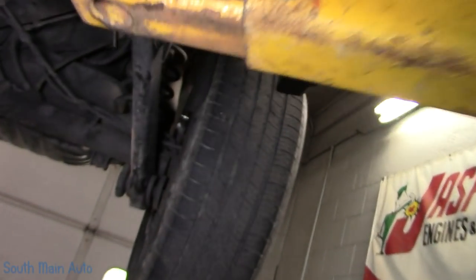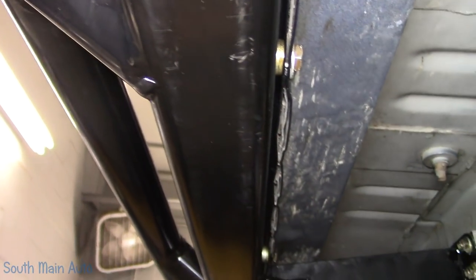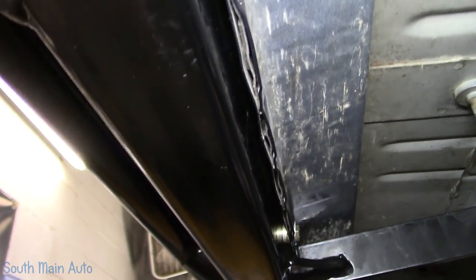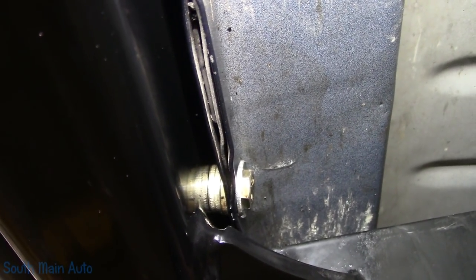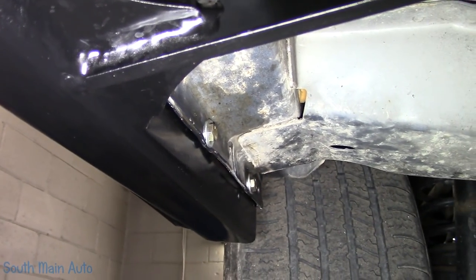All right, and then we come to the back, and up there it was perfectly tight. But as it progressed down through, you're not going to flex this tube. Plus, you can see the gap right there that I had to make up. So it's about three washers. It's better than 3/8 of an inch. I knew that it wasn't going to push that pinch weld over that far, and it kept that same trajectory all the way down through the driver's side until you got up to about the front two bolts, and then up there it fit pretty flush.